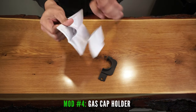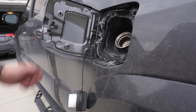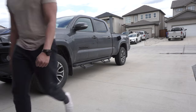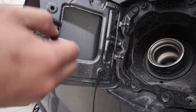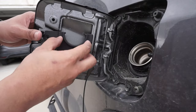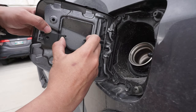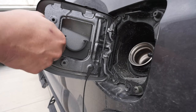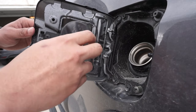Now let's install this gas cap holder on the Tacoma. This is very lightweight and easy to install. Currently, when filling up gas, the cap will either have to hang onto the side of your Tacoma, or some owners use a hook to hang the cap on. Grab a screwdriver and remove this screw. With this install, we'll have a cleaner and more secured way of storing the cap when fueling — this will avoid scratching the side of your truck. Attach the gas cap holder on the existing Tacoma slot. Once it's all lined up, simply reinstall the screw that you removed and tighten it. Now you can use the slot to house your cap when fueling.